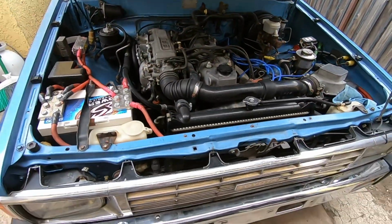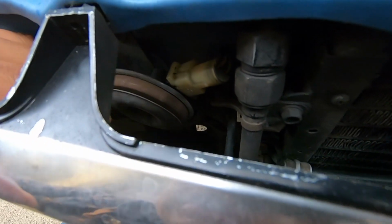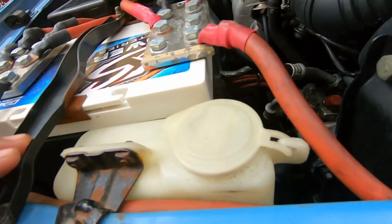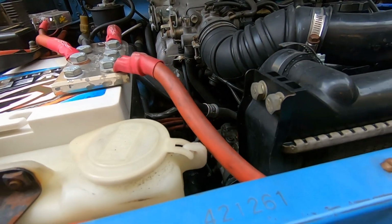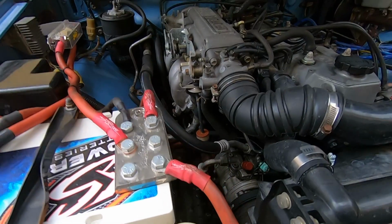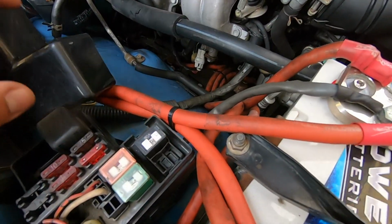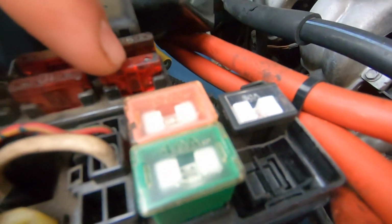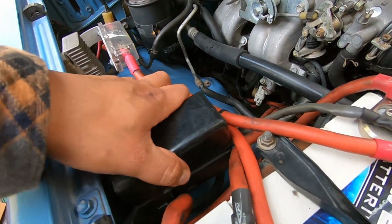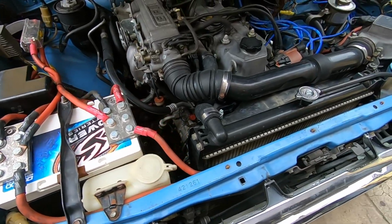First, we're going to make sure that the horn is even connected, which is right here. You can see that the plug is in, so it works. And we were looking up the fuses, and the one for the horn and the hazards is the same fuse, and it was blown actually. We just didn't record that because we're trying to get the hazards to work, and it's this fuse right here. It's a 10 amp fuse, so we got that replaced. Now the hazards do work, but the horn still doesn't work.